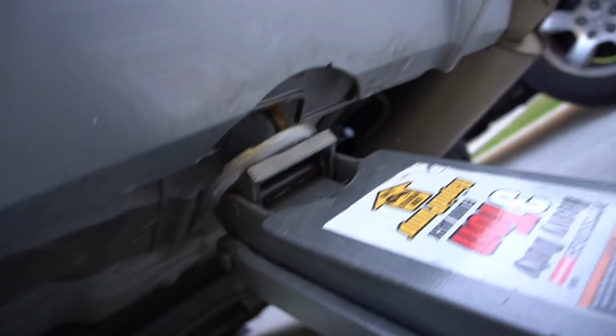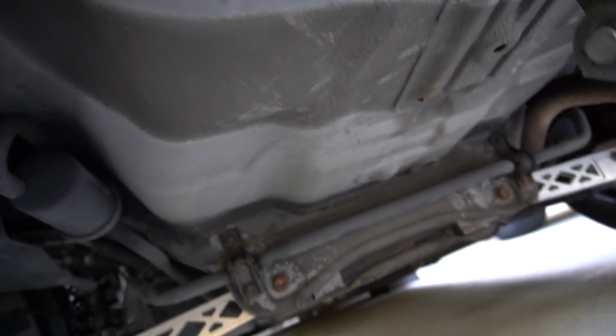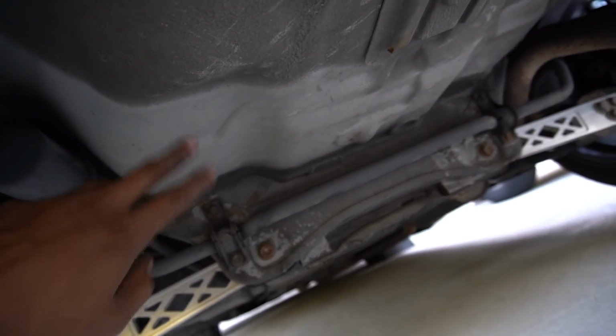I don't think I have to actually remove the wheel. So jack the car up, put down jack stands. I'm not going underneath the car because, you know, I ain't trying to be safe out here, bro. Jack it up, put jack stands, and then we'll just install it from there. It should be easy though. All I'll do is two sway bar bolts. Yeah, it should be cake. Should be easier than installing it on the DC2.